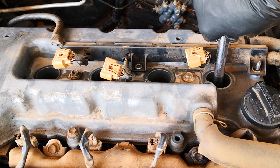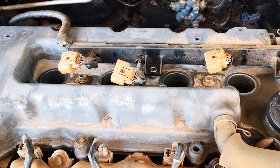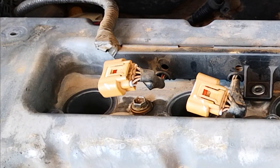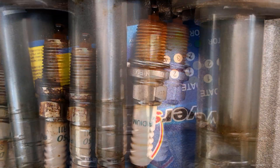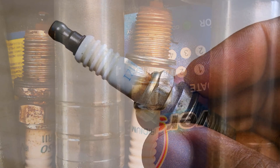In order to identify the best cylinders to use for this demo, cylinders 1 and 2 are in their exhaust and intake strokes respectively, and those are the ones I'm going to use. However, even before going into the cylinders, just by looking at the spark plugs and the ignition coils, it's evident that we have a leaky valve cover gasket. It seems to be lesser on cylinder 1, judging by the absence of corona stains on the spark plug.